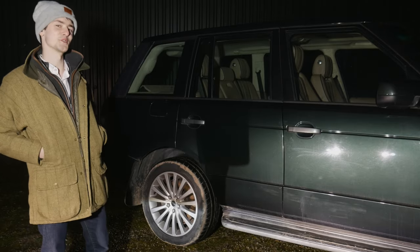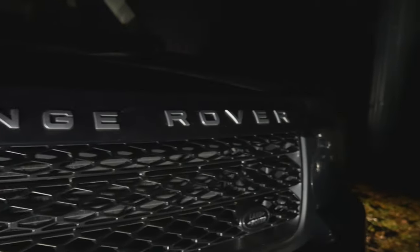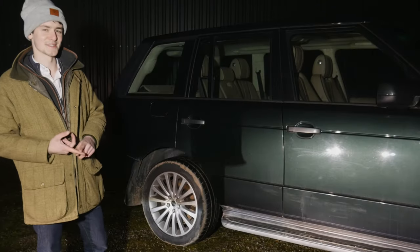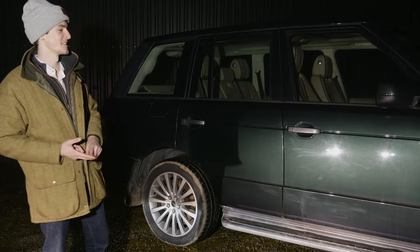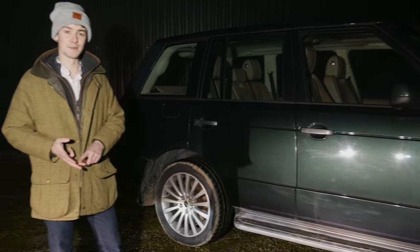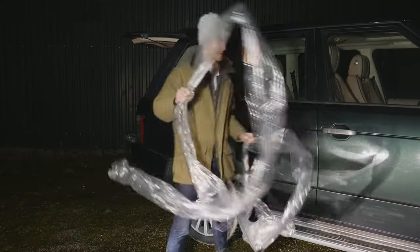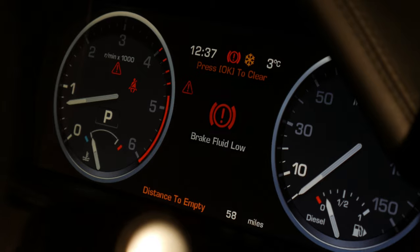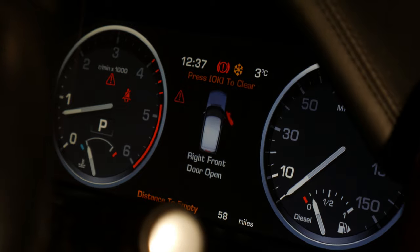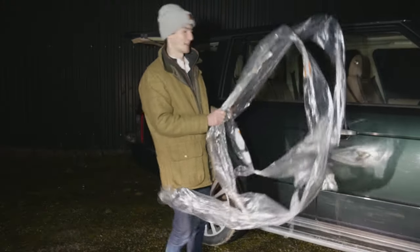What work needs doing to the car? Well, it doesn't have an MOT — it arrived here on a trailer. Front tyres, definitely. It probably needs front discs and pads. The brake lines are currently burst; I have some new brake lines in the back of the car. These are the brake lines that go from the front to the back — they're currently burst, so all the brake fluid has leaked out. So the first job, which is probably the most important, is to replace these brake lines.